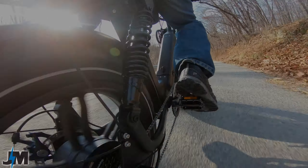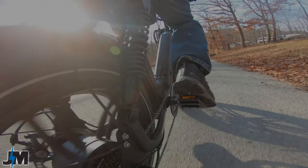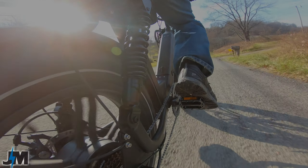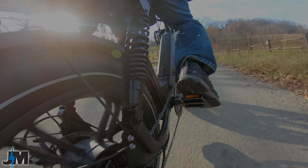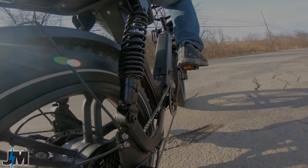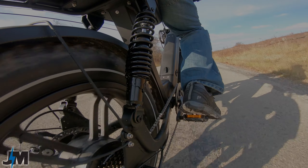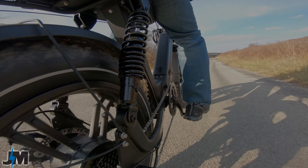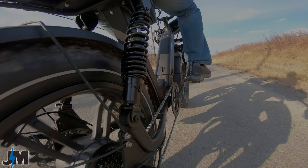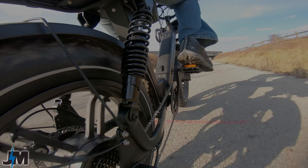For many people buying this style of bike, they're not going to be buying it to pedal a lot anyway — it's more of a moped. With that said, being 5'8" it seems pretty comfortable to pedal. Even though these aren't hydraulic brakes anymore, the Tektro Aries brakes seem pretty good. There might be a little squeak that needs adjustment but stopping power is still pretty good. I toned down pedal assist 1 to 25%, which gets me right around 6 to 7 mph — good for slow riding in town. Level 2 set around 35% gets about 10 mph.